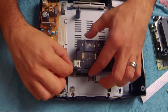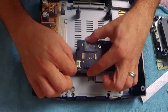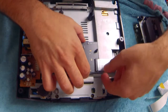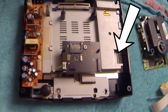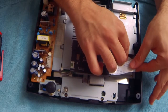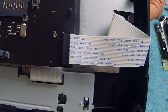With the Phoebe in place, we can now reattach the power cable and the new flexible flat cable. Start by inserting one end, conductor side up, into the Phoebe connector slot. The other end goes into the connector slot built into the system. This is a straight shot, so make sure you don't unnecessarily twist the cable. In order to get the cable to lay flat, you will need to fold it over itself — something like that will do.